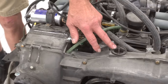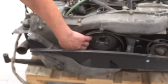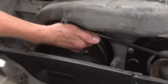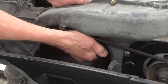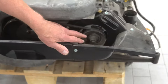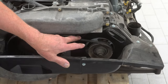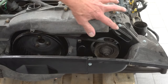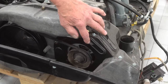The timing hole plug is right here — this is where we check the timing. The engine fan: when you're turning the engine over you can grab the fan blades and turn it to top dead center if you have to, and you can see that even with the spark plugs in it's fairly easy to turn. This is the alternator. You can see the alternator belt deflection is about right — nobody ever remembers to check it because it's hidden, and then the alternator breaks out of the blue. These are the two access plugs to adjust the alternator when you put a new belt on.